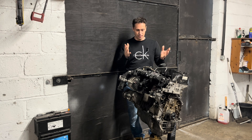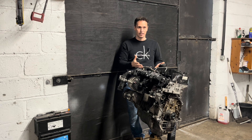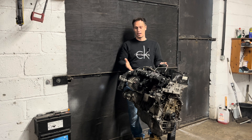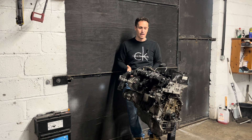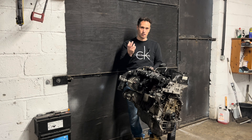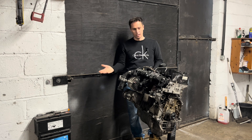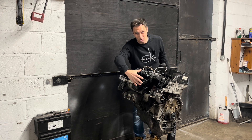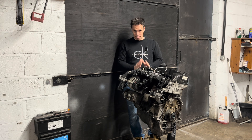Personally, I'm not a big fan of these engine rebuilds, but I'll be honest with you. A few of you asked in the comments when I posted that video, why not fix the engine? Why not grind the crankshaft? Well, it's not 100 pounds — it's 140, 150 plus VAT to start with. And if you want to do it right, it's a lot of money. You have to put new bolts on the main caps plus the con-rod bolts — you need new ones. You need good quality bearings, and you should clean all this stuff. The oil pump is questionable.